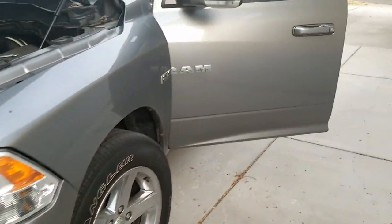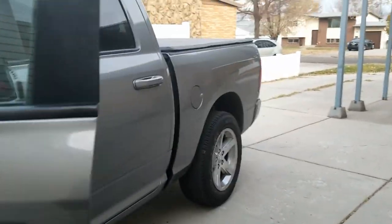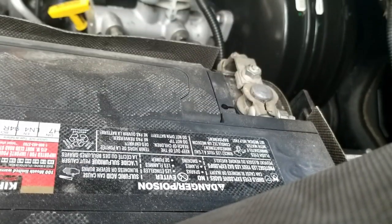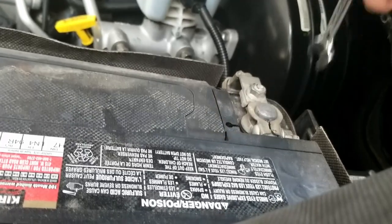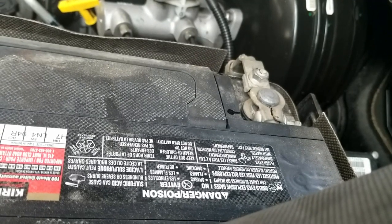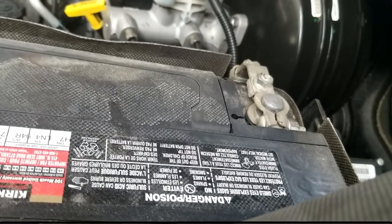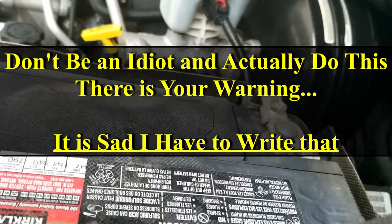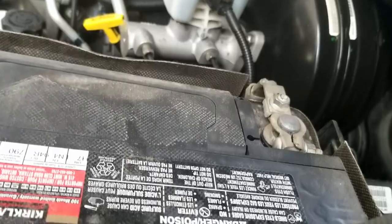Of course, I have a laundry list of things I want to do to it, but we're starting off today. First thing I'm going to do is get this stereo in. So let's get started. First things first, don't be an idiot. Take your good old 10 millimeter and take off the negative terminal before you're working on any electronics. Or if you want a really happy fun time, take a really long screwdriver, put it between your teeth and stick it between each terminal — it's shockingly fun.